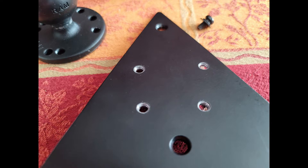I put up the Ram ball mount, marked the holes, and simply drilled them out and used some hardware to mount it. The head units on the front stand off a little bit, so there was plenty of room — I cut the screws to length with a Dremel and put some nuts on there. The mounting for that ball unit worked out just fine. They're not that close to the backs of the head units, so there are no issues with rubbing or scraping. Just marked it with a Sharpie and drilled through — it's pretty soft steel.